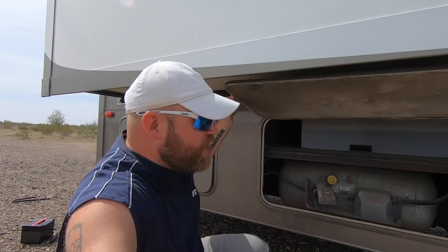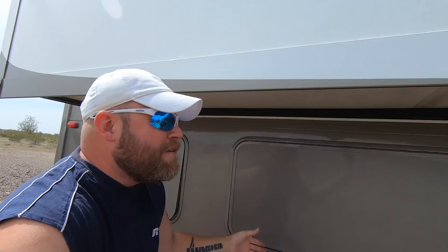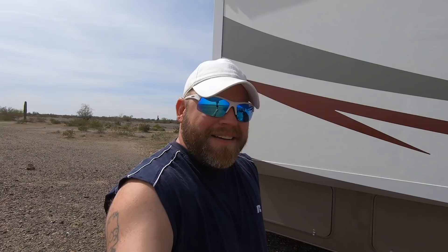They don't have room to do anything else — there's a steel floor all the way through for us to stand on inside the RV. I've got about a half inch of clearance above the tank. Because of that steel floor, they didn't have the option to bring the vent up higher than the top of the tank, so they just run it straight to the ground from the top — which is a terrible idea. A bunch of people have realized their entire tank can be emptied in a day.